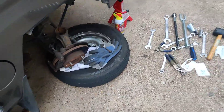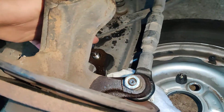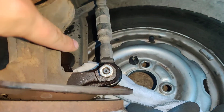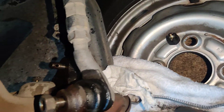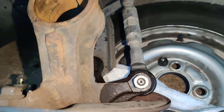What I was going to do was actually take the whole knuckle off, take the outer tie rod — I got the nut loose — and take the lower ball joint in to match the threads. The problem is my outer tie rod does not want to come off, and I don't want to damage the boot. I probably already damaged it a little bit, so I'm probably going to have to try to repack it with grease somehow so it'll last.